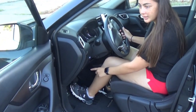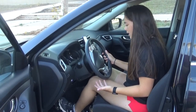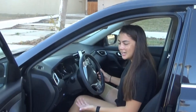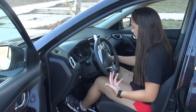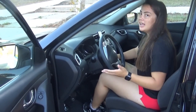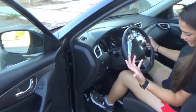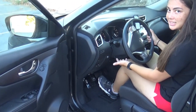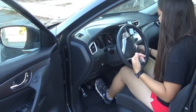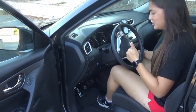It beeped at me again saying 'push me,' because what that button does is it initiates the left accelerator pedal. Now the traditional accelerator pedal does not work, but the brake and the left accelerator work as in a normal car — it's just on the left side. When you turn off the car, everything resets, so a friend driving my car can drive it like a normal car — the left accelerator doesn't work unless you press that button. If you don't press it within the first 30 seconds, it doesn't work anymore.